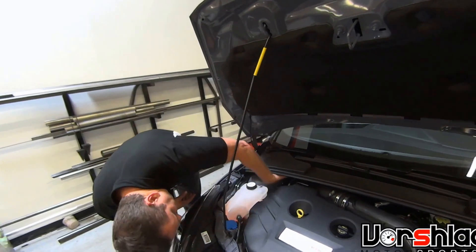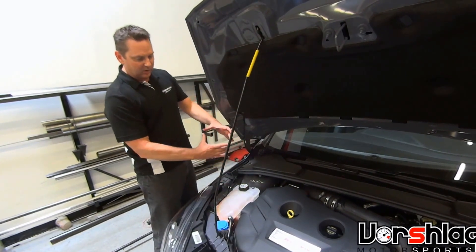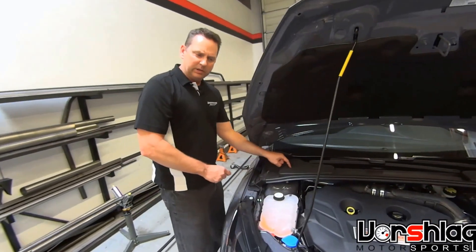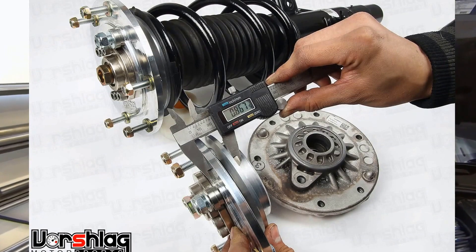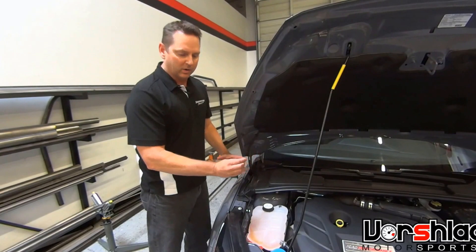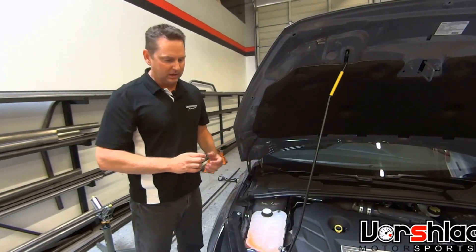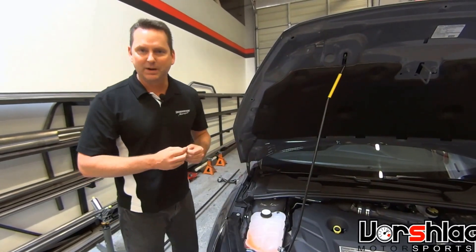There's a big strut tower brace, but the biggest problem is the strut tower itself is pretty small in diameter and the OEM spring is very big. To be able to get any camber adjustment, we've got to move the top of the strut inboard — we really need about three quarters of an inch of travel. 95% of the cars out there we can do this, but this is one of those 5% where the spring is so big it physically has nowhere to go. There's less than a quarter inch between the spring and the tower; it's going to bang into the tower if we move it a fraction of an inch inboard. So we can get no camber adjustment out of it, which really reduces the need for a camber plate right now.